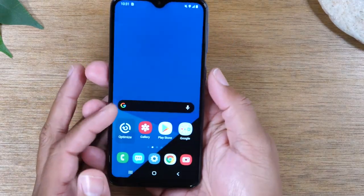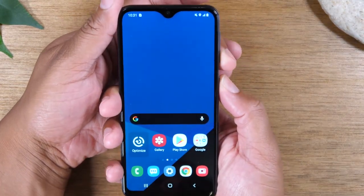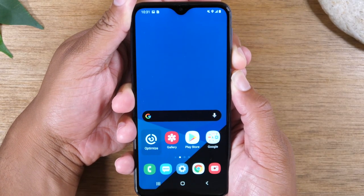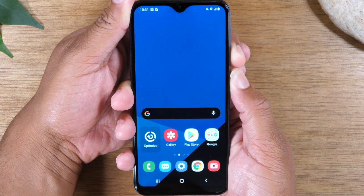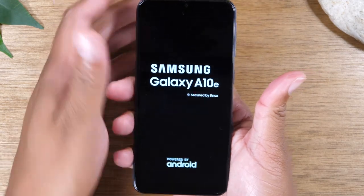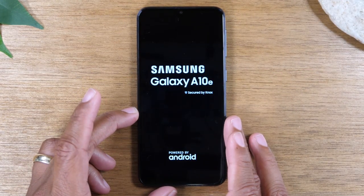What you're going to do is hold the power button and the volume down button for about 20 seconds, or until the phone resets. You will see it take a screenshot — just continue to hold the buttons and you will see the screen go dark and vibrate, and then just let it go. That will successfully trigger a restart.